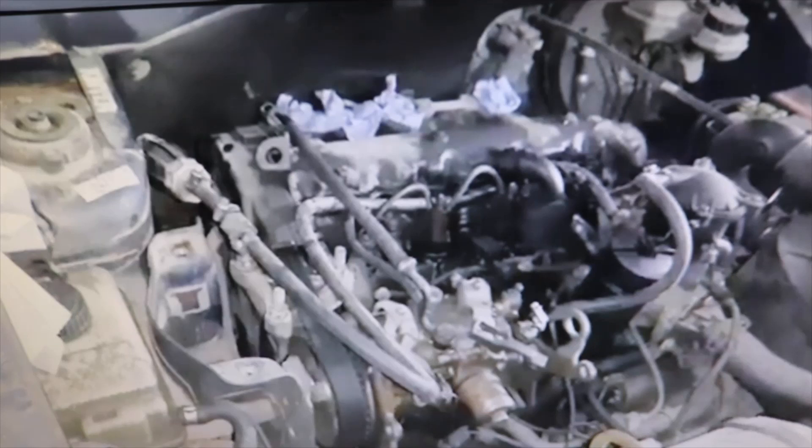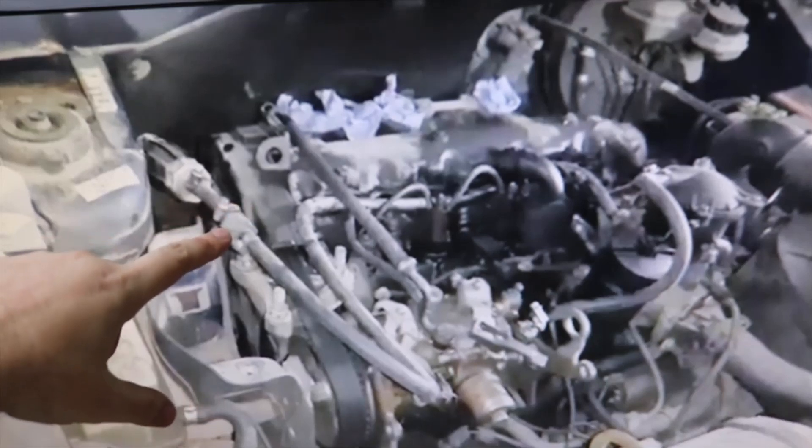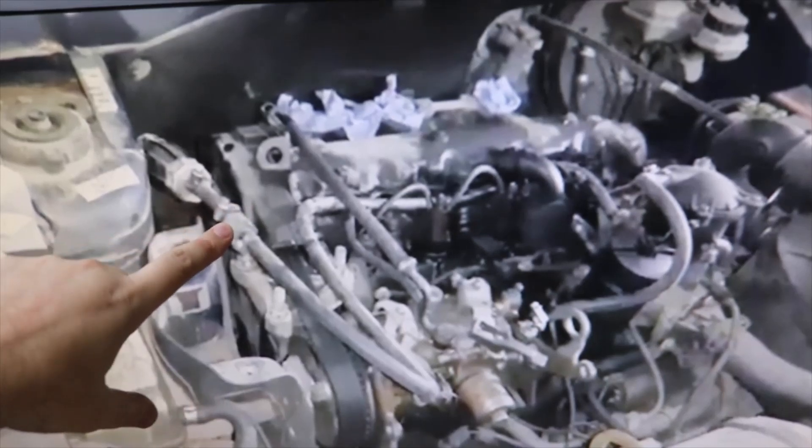From one day to the next it was very difficult to start the engine. The owner, wanting to save money and looking at videos on the internet to see how it could be solved in the cheapest way, installed a non-return valve here — but incorrectly installed. I am going to explain why. The problem comes from the high pressure pump — there you will see the non-return valve.